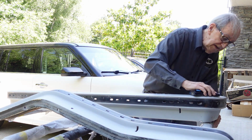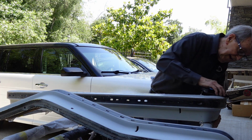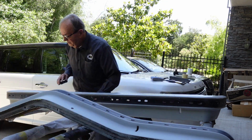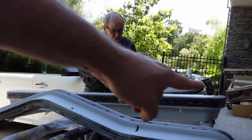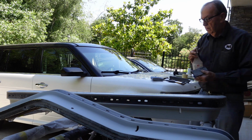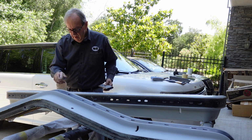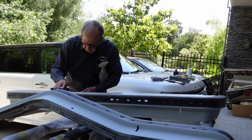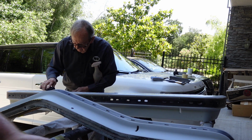So we are up to 600 wet now. Pops forgot to put the guide coat on, so I had to reset. Yeah, it was so perfect, I didn't need it. Come on. I had to reset him. This guy's done, I believe. I just did the epoxy section there with 600. I see a few shiny spots there. So I'll go over all of the little holes in the bumpers and stuff with Scotch-Brite. To get all those out, and I'll just give that a once over to make sure it's good. But these guys are pretty close to being done. Yep, they are. I'll just leave that there for you to watch Pops work.